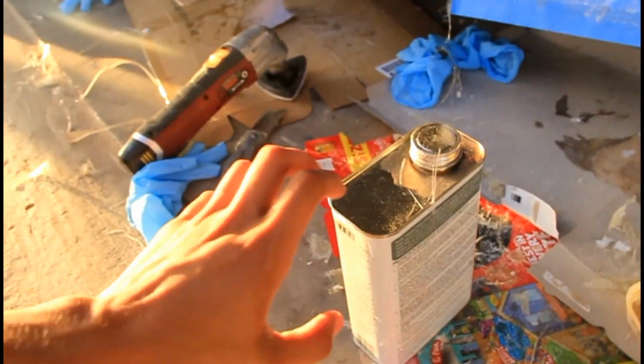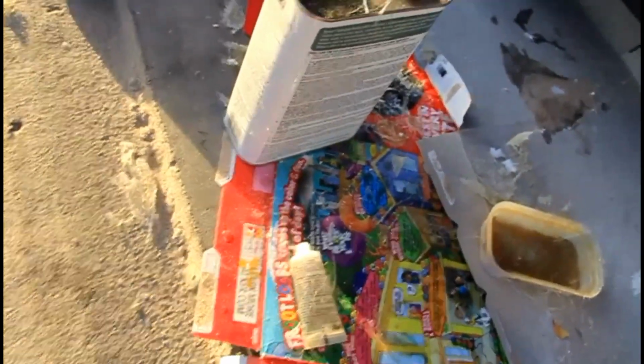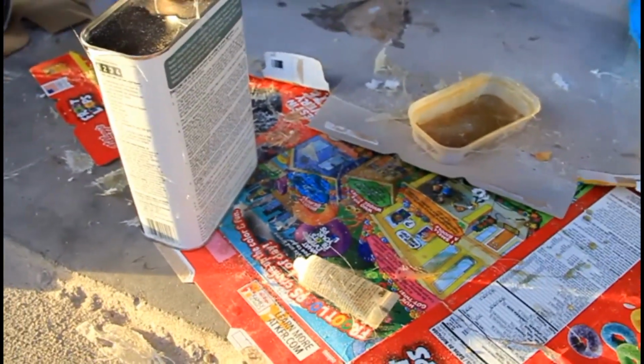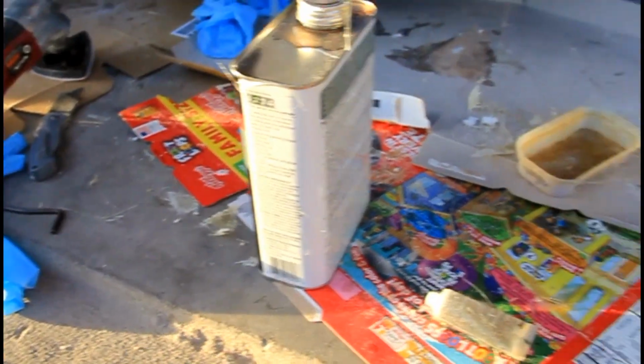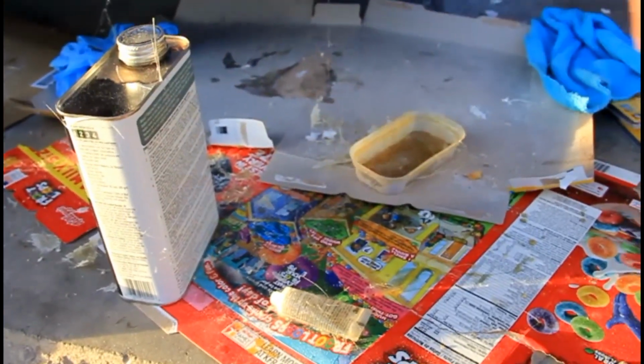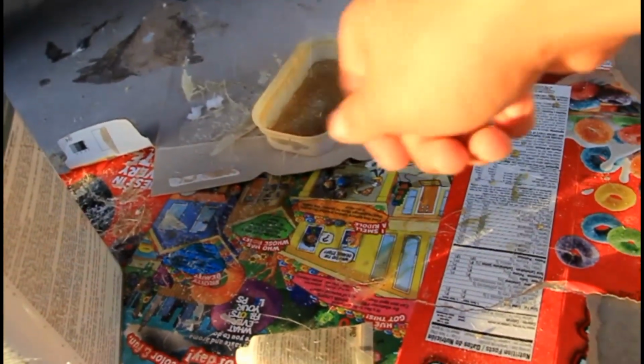Your first item is the resin, then you have the hardener, and again, make sure you have gloves for all this stuff, because with the foam it just sticks on. It's a bit of a pain. This stuff is the same thing, but it also gets in your skin, so it's a big deal. The only reason I don't have gloves on right now is because I'm not actually messing with it. Anyways, what you're going to want to do first is pour the resin in the cap that comes with the fiberglass or any other type of plastic container. Then after the resin is in there, add hardener to the resin, take a piece of cardboard, mix it in, and then take the fiberglass mat and dip it in there, make sure the mat is covered as much as you can, and then lay it on the spot that you want. So that's a rough little rundown.